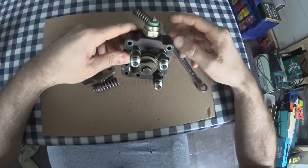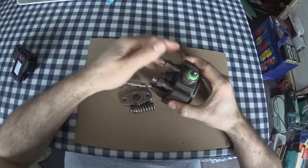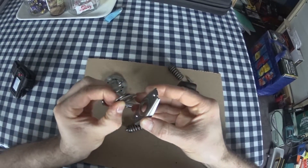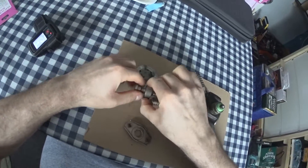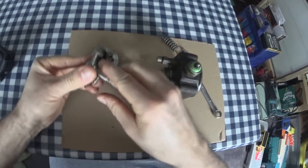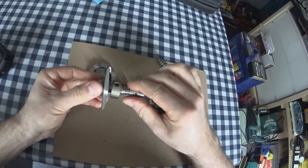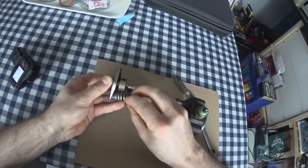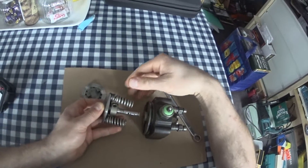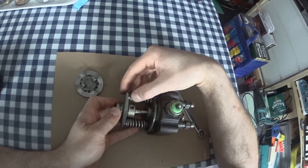That is your stop solenoid. It just bolts to the back of the pump with four bolts and an O-ring. It has got a thrust washer on there and goes in front of the control sleeve. This is all off a dead EDC pump that someone donated to me, which was off a WLT-3 — a Euro emission one with the EGR cooler, electronic pump, EGR valve and throttle shutter. But essentially it's a WLT — everything else about it is the same apart from the pump.